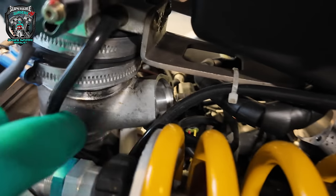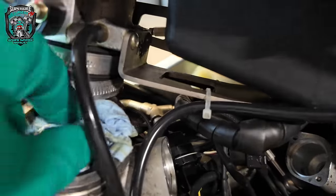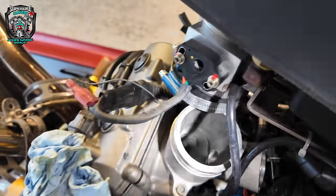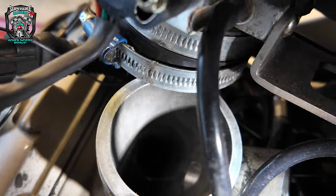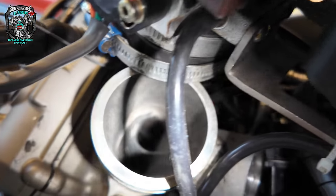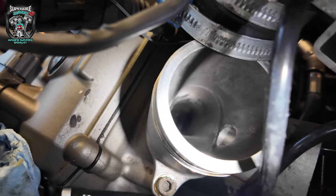Let me just show you where the injectors go into the throttle body - I've got a torch. The injector goes in here and basically the injector is going to spray on the backside of the cylinder head. It's not even pointing vaguely at the valves. It's a really shit design. I think this is why all these SB8Rs have suffered with fueling issues.